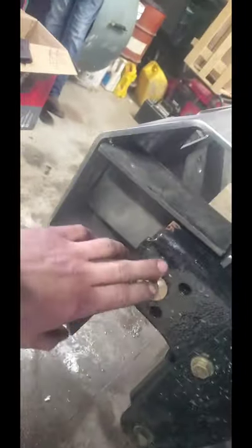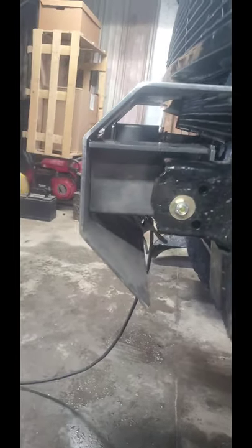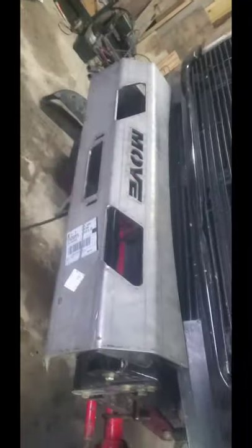I got the center section and marked the center here and the center on the truck, then adjusted accordingly. Right now I've only got single bolts holding it on — I made it perpendicular to the ground. I haven't welded the brackets yet because I want to wait until I get everything together in case I need to make any fine adjustments.